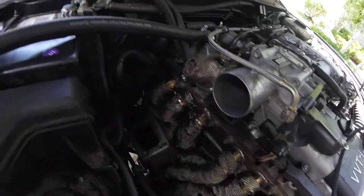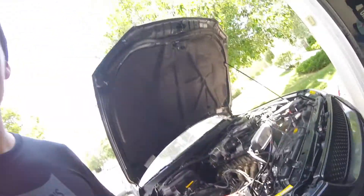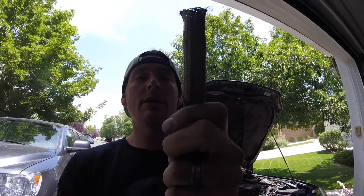I'm in the process of pulling out the old turbo to put my new turbo in, for what I thought was a blown turbo, because I had oil coming back up through the seal of my turbo. But the first thing I immediately noticed when I took my turbo out is my oil return line is collapsed. Basically what had happened is the heat from the exhaust manifold actually melted the insulated oil return feed, and so oil was actually just backing up into the turbo because it had no place to drain.